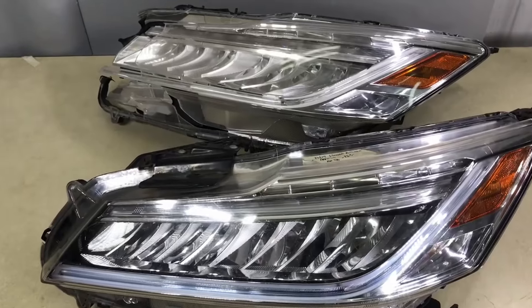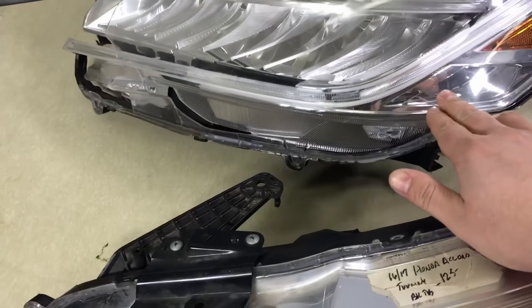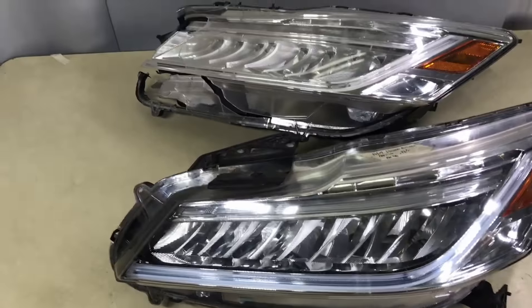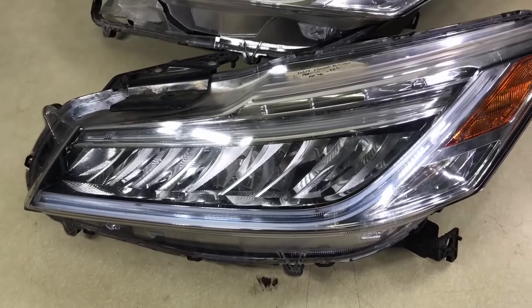In this video I'll show you how to swap out the LED. I'm going to use a broken headlight — remove the LED from the broken headlight and then swap it into the good headlight. The broken headlight I tested and it's working, but the good headlight's LED is not working, and I'll swap it.